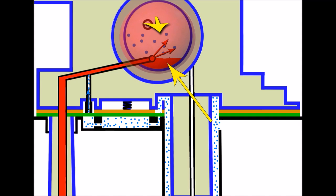That vacuum — because the bulb's expanding outwards — is pulling the fuel even further, and it's all going up into the back there of the primer bulb and starting to fill that area. That's why it's vital that these primer bulbs are in good order. If there's any even a tiny pinprick of a hole in there, we won't be able to create that vacuum to draw that fuel up.